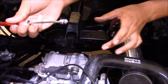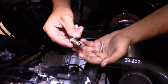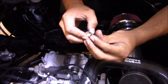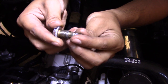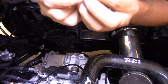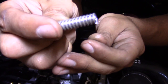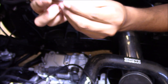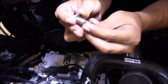So now I'm going to set it up and show you guys what it looks like. When you put it back together, you're going to get your bolt, put your spring in here, and then carefully — this is basically what it looks like when it's in your trans. You have the bolt, the spring, and the spring pushes against this ball. Also, I didn't mention — it looks like it's a dual coil in here. I don't know if you guys can get a good look at that, but that's also probably what's making it stiffer. This is how it goes, so you're just going to put it right back together, torque it up, and then do the other two.